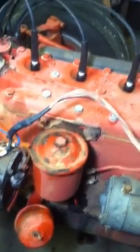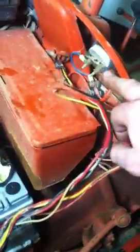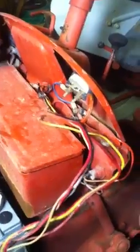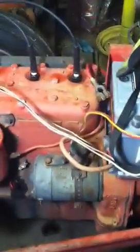You're going to run one wire to your voltage block up here, and then run one wire back down to your battery. You can hook your switch in here too — hook your switch into that circuit so it breaks the circuit. When you turn it on, it powers everything up. We're going to get rid of all this wire. There's going to be one wire running down to your starter and one wire running to your new alternator. All this other stuff is going to go away. Simple as that.